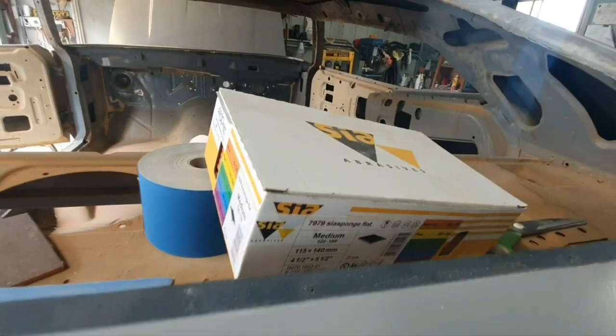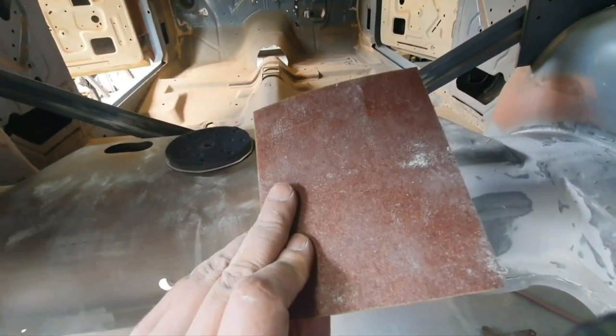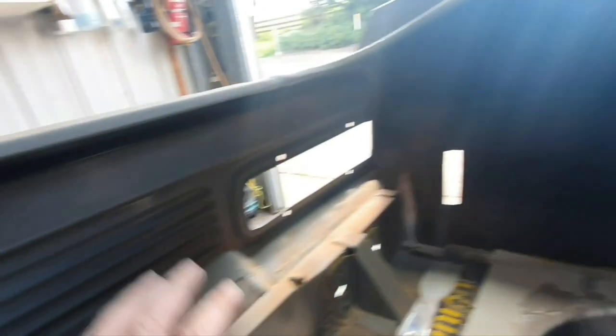Going across the other side — same situation. This side here had severe damage from a sideswipe, so same with this side regards to the section of stuff from rear spares. What I'm doing now, I've got these sanding pads — it's all been epoxied in here, but I'm just scuffing it all up.